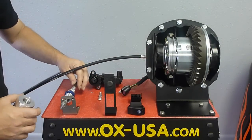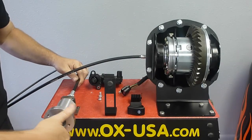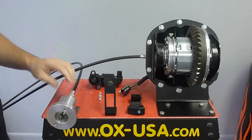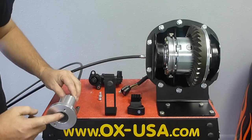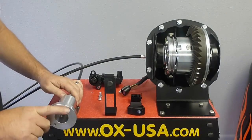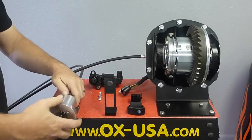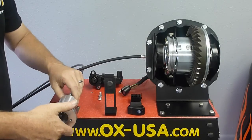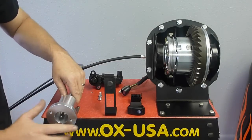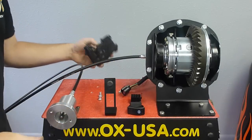Mount that into the shifter mount bracket and screw on the body. You can see the little plunger inside there — the proper adjustment is to keep that plunger below this surface just a little bit, somewhere about an eighth of an inch or so. Adjust it until you have that about an eighth inch below; that's a pretty decent setting right there.